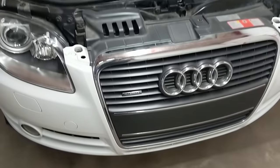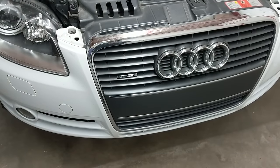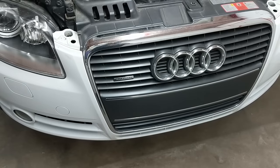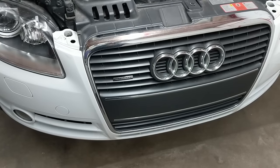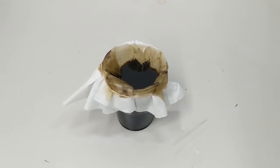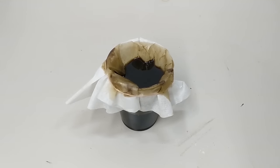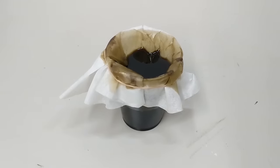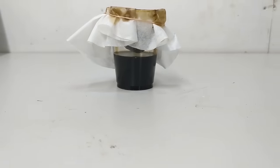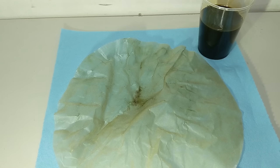Since the engine's still a little bit warm, I'll go down and grab my first sample of used oil from the pan, get it filtering on the bench, and take a look at the average amount of settled deposits in the pan. The sample I pulled wasn't the dirtiest oil I've ever seen before — makes sense, I knew there wasn't tons of kilometers on this batch. Nonetheless, it's filtering through the paper now and we'll see what's left on top.